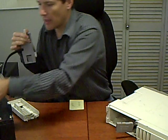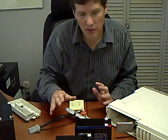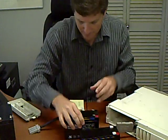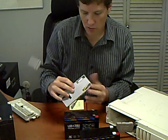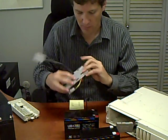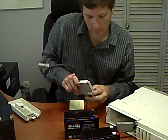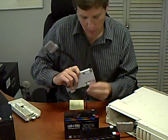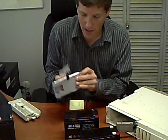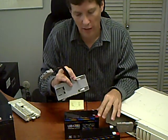Those are the two batteries that need to be replaced. In your shipment you're going to have two new batteries. It's not always apparent to everybody, but there are some protectors sitting right on top — you just pull them off and throw them away afterwards. I typically like to use the side that's flat, not the side where the wires are, as it's easier to start with. You'll notice that it only fits one way and the leads are always on the same side. But in this particular case the yellow wire is actually connecting to the black on the battery, and the red and yellow wire is actually connecting to the positive, which is also red on the battery.